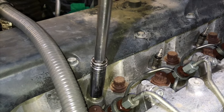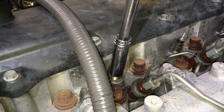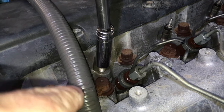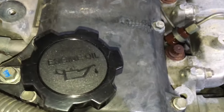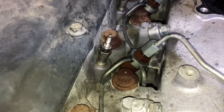You need to watch your procedure because these can be tight. Once the glow plug gets toward the end of the thread, you want to get the socket off and carefully bring it out without banging it — you don't want the tip falling off into the engine. The wiring loom can be moved forward by removing a couple of clips; that lets you work around it to get the valve cover off later. First glow plug is out and the tip is intact — good news.